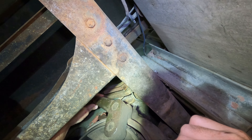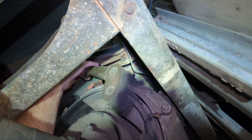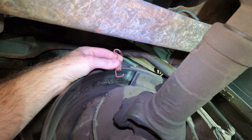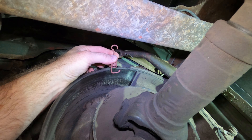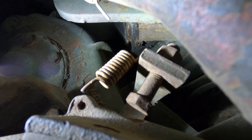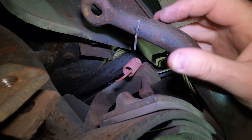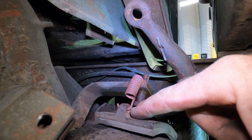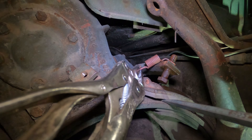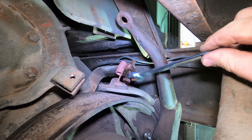The outer parking brake pad pivots on a bolt at the bottom. The first adjustment is to eliminate as much side-to-side play in the pad as possible while still letting it pivot freely. I loosened the lock nut using an inch and a half socket, then using a 33 millimeter socket, I tightened the pivot bolt until I was happy with the amount of play. After I put the lock nut back on, the pad would no longer move at all, so I had to back the bolt off just a little bit. It took a few iterations until the pad was correctly adjusted with the lock nut tight.